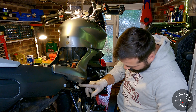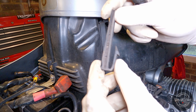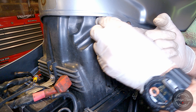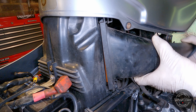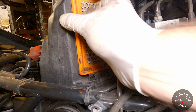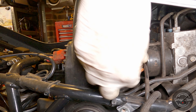One, two on the silver one, and two more on the black one — so five bolts total. Take those off, then pop off these plastic wedge-type clips. The top one is harder to get out because of the fuel tank. Then I can pull off the inlet and expose the air filter — it's got a stud going through a rubber grommet at the front. Here's the air filter; a bit dirty on the front but not too bad — it actually seems to be quite clean.